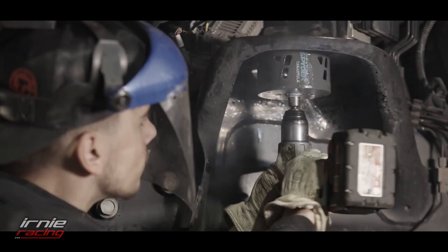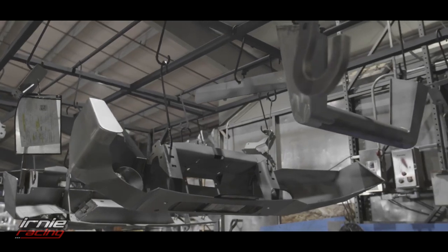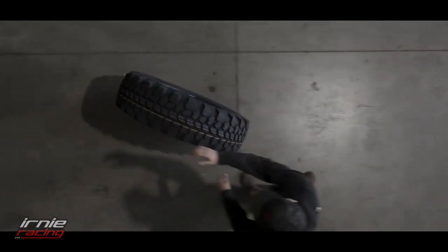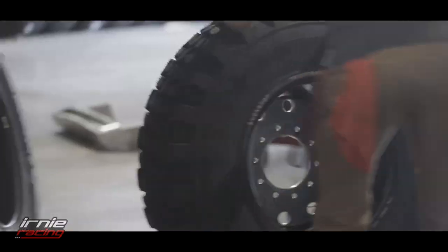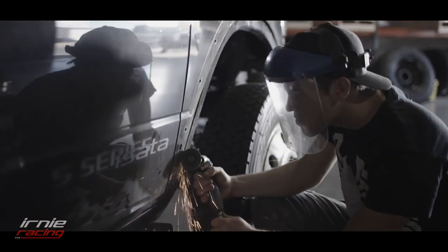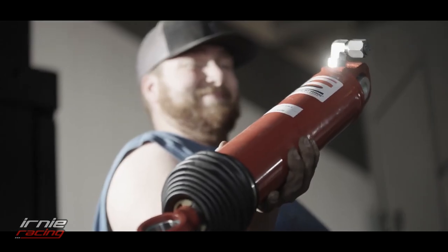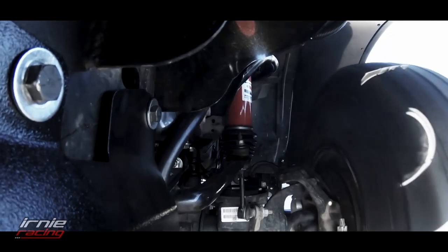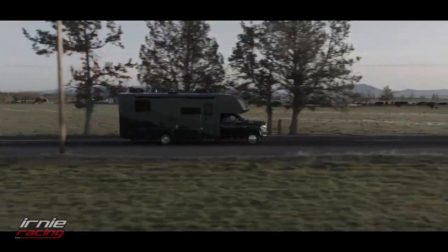It's rough, but Liquid Spring is an electronically controlled suspension. It's a 6% compressible liquid. They remove all the factory suspension, the coil springs, leaf springs. The rear gets a 4-link with a Panhard bar and big struts on each side. Same with the front: the coil springs go away, and you get new trailing arms and struts up front. Every strut has its own chamber. It's computer controlled from an ECU from Liquid Spring, and it's always adjusting the spring rate. It's like the smart suspension in the side-by-sides, from Polaris to Can-Am. 0.04 of a second. The processing is so fast that by the time you hit something on the front, the rear is going to adjust for the same bump. If you get side winds, it will change the spring rate to stiffen up the other side.